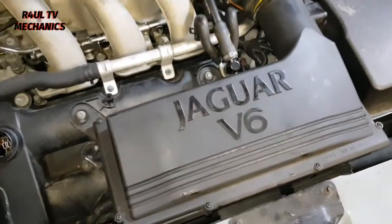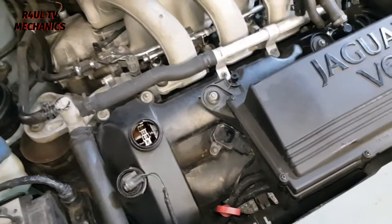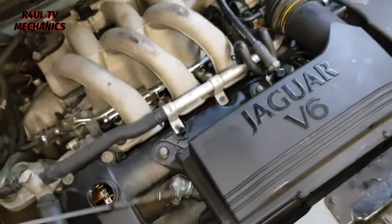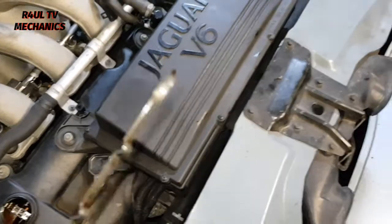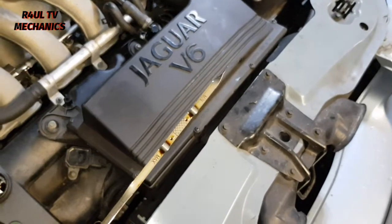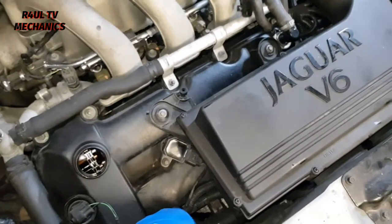Right, so the oil filter is on, the air filter is on, the car is sent back down. We're going to get some oil in there. It takes about 7 liters, 7.5 liters, this car, round about that much, but no point putting 7 liters in or anything like that. Best thing to do is put the oil in accordingly, and the dipstick's here, just check it on the dipstick. You can't really go wrong. The levels on the dipstick, as you can see here, are maximum and minimum. Get it towards the maximum, start the car up. Obviously it will drop down a little bit, and then what you do is top it up, job done.